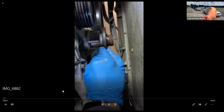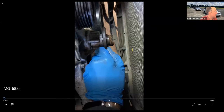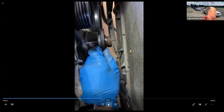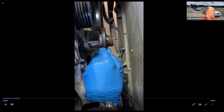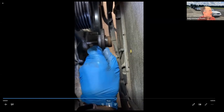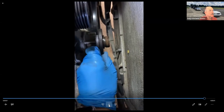On the video, you can see my blue-gloved hand on the hub of the water pump — watch the motion. For me that was a shocking amount of play on the water pump hub, and that was the cause of the noise. I would have hated not to find that, because it was a disaster waiting to happen.